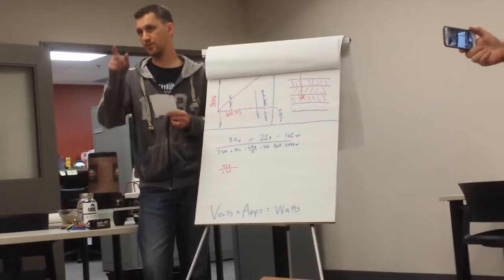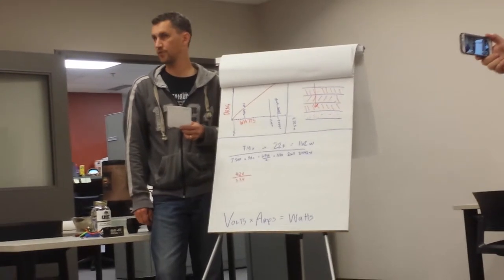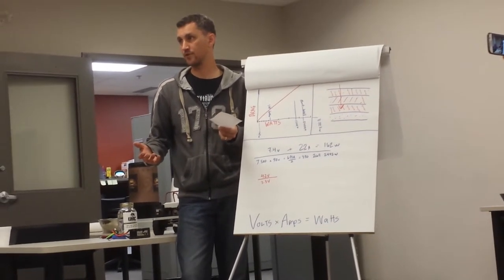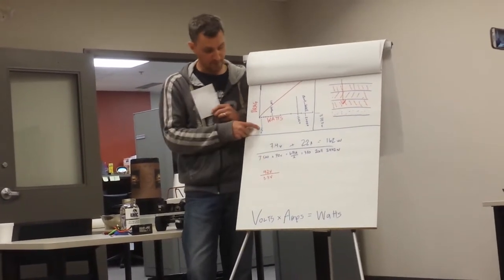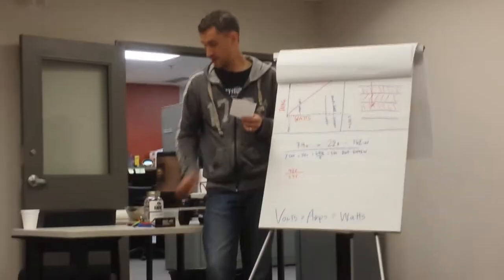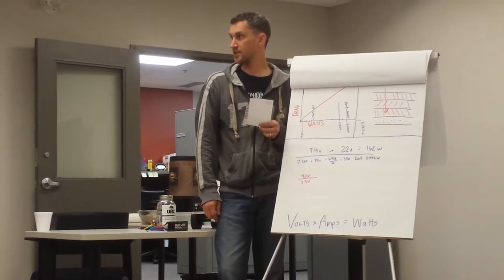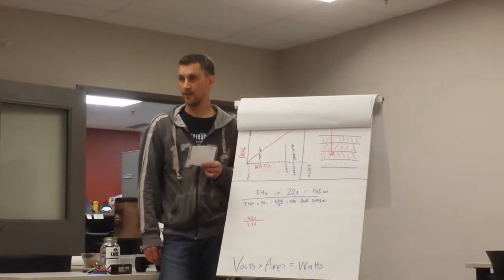So, the battery that was in the Jeep that melted didn't show any signs of puffing, but it had been in there for probably 4 years, and we don't know when it was manufactured. Let me just suggest the battery was 3 or 4 years older than that. I'm just going to guess, so let's say that battery was 6 or 7 years old. Even though we were hardly drawing any power out of it, it was a scale truck, right? The battery had an 80 amp nominal capacity. I was only using maybe 10 or 15 out of it, so I'm not drawing it enough to do this. But this was probably happening while I'm not looking, just from age. So I expect the plates finally contacted each other in the truck just because of age. And then look out because they really are a really high power thing.